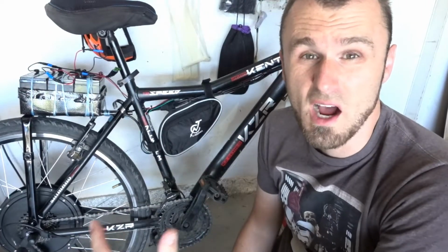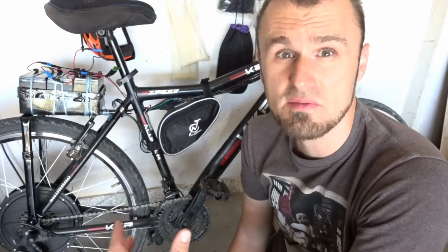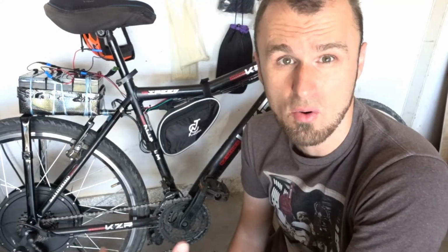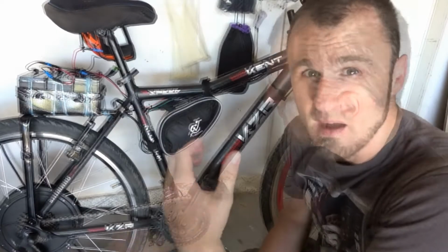If you don't care how your bicycle looks and you want to save a bunch of money, get these batteries used. Two of them I had used, one I bought online, so basically I'm $22 in for a bicycle that has a 10-mile range at full speed, full throttle. I could easily go 30 miles in pedal assist, especially if it's not going to go over 20 miles an hour, where the most energy is spent by the motor to push you over the 20 miles an hour limit.